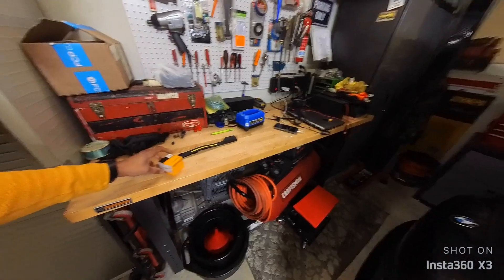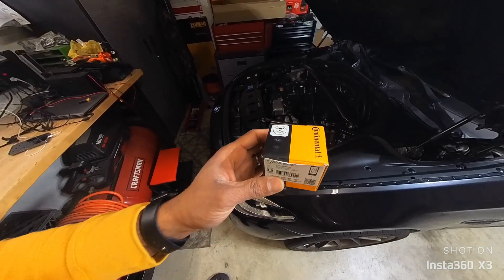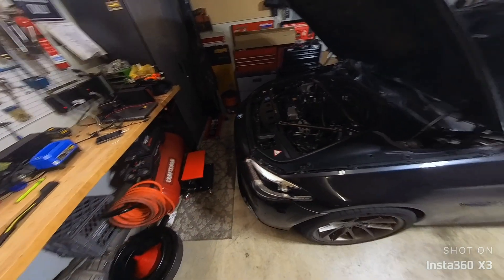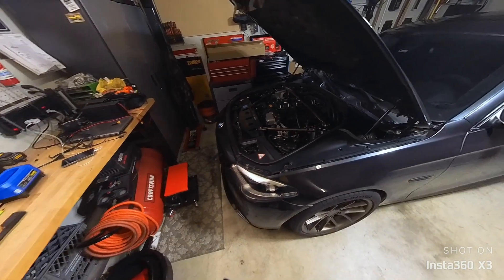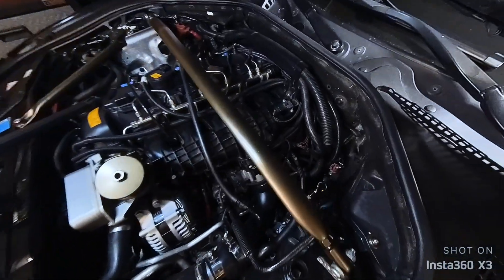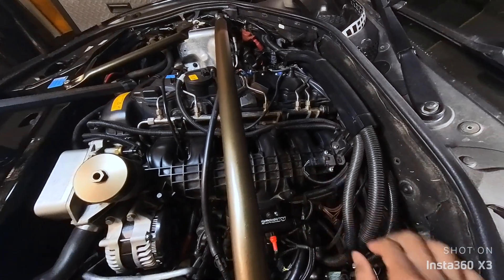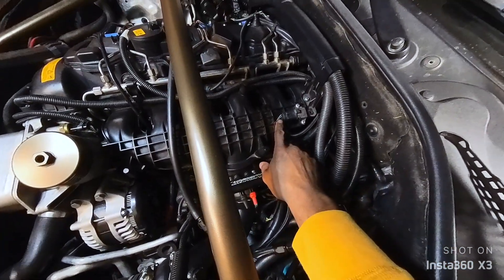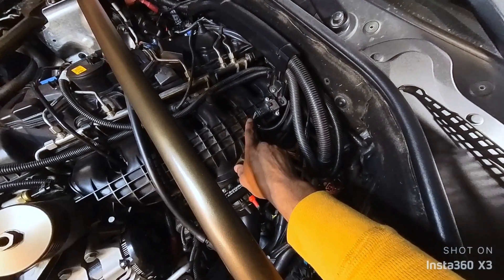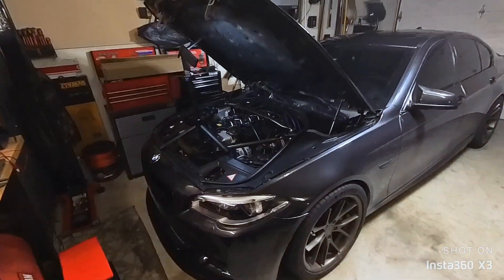Our Continental sensor is right here — this is the 3.5 T-MAP sensor. I'll put a link to the part number in the video description. Hopefully the lighting is okay — let me get a light out real quick. So what we're actually going to replace is right here in the intake manifold — this is the original MAP sensor. Down here is where we replaced the one in the charge pipe. I'm going to unplug the connector, replace the sensor, and get everything reinstalled. I'll do that off camera to keep this video short.